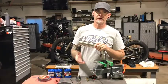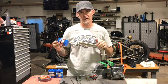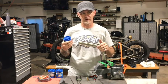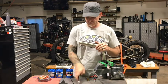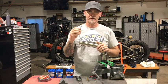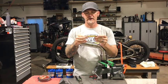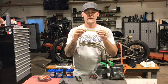A few tools you're going to need: obviously the header wrap, some safety wire — Wire Care offers the TechFlex safety wire in light, standard, and heavy. For this application we're going to use the lightweight stuff; it's easier to bend and work with, and for what we're holding the lightweight is fine. A set of wire cutters, a pair of scissors, and we might use a couple zip ties for a helping hand. Wire Care also offers the clamp tight tools, which are super handy. This is going to be a two-part video — exhaust wrap and how to use the clamp tight tool.